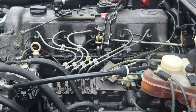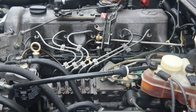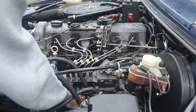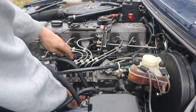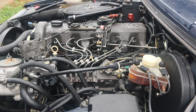We are going to have some air in this system quite badly. I'm going to pump the primer pump to make sure that the low-pressure side of the injector pump is free of air. George is going to help by walking in front of the camera so you can't see what's going on. That little sound is the overflow valve here opening — that indicates that it's all full of diesel. Now we're going to try and start this thing up and see if this makes any difference.